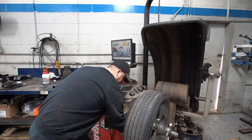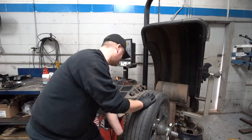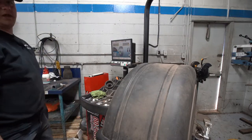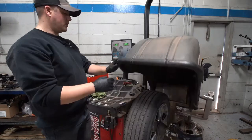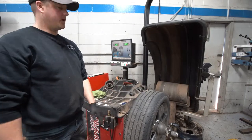I'm going to press the brake on the machine, give the wheel a wipe where I'm sticking it so it has good adhesion, then place the weight on and give it a good hard press to make sure it's going to stay. Then I'll release the brake, put the hood down again, and it's going to spin the wheel to see if it's in balance. It comes up okay — so now we know that wheel is balanced. We'll do that for each of the four wheels on the car.